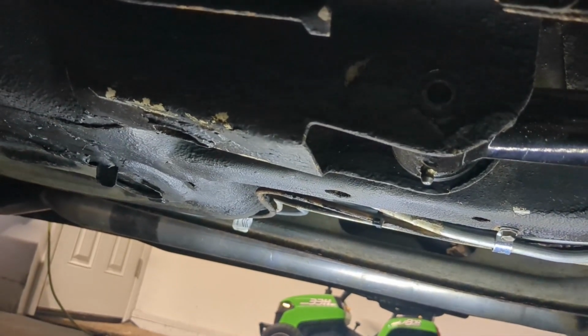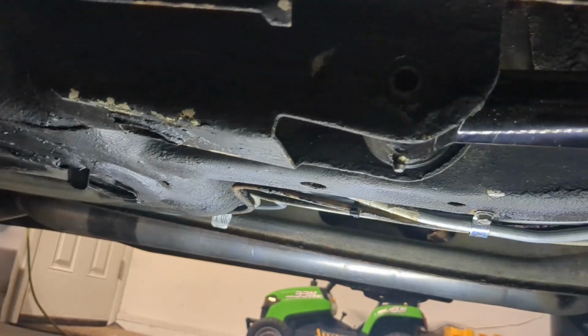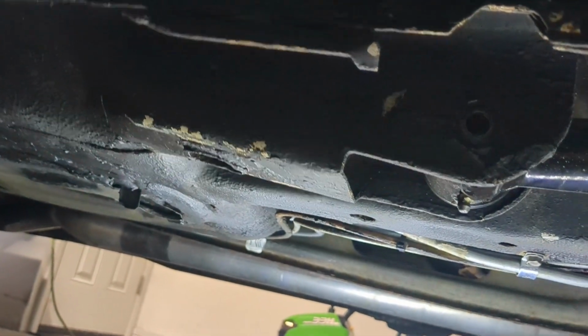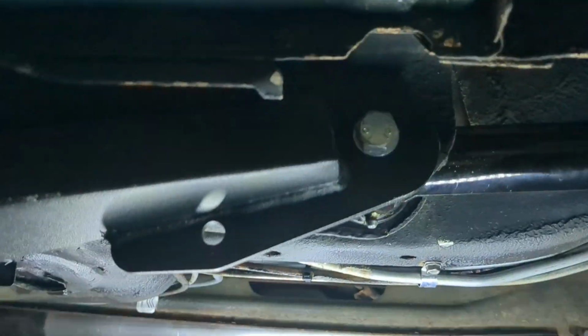I need to go get the subframe connector, because again, this bolt is gonna hold that back side in. So I'm gonna go get the subframe connector, get that in. Then we can literally just swing this thing up, get a jack underneath that once we get the bolt back in, drill holes in the floor. That was wonderful. I literally just slid the bolt right in, and my subframe connector is now on the vehicle. Not completely, but it's ready to go.